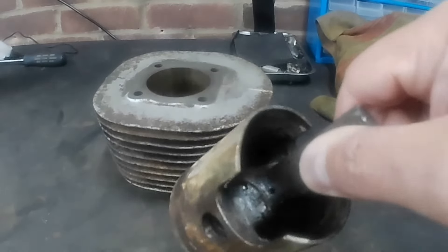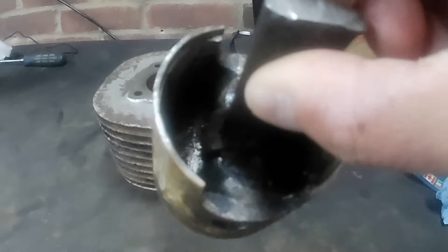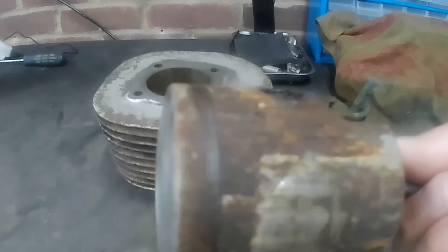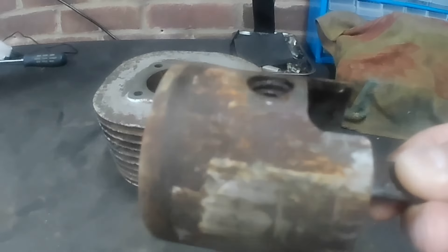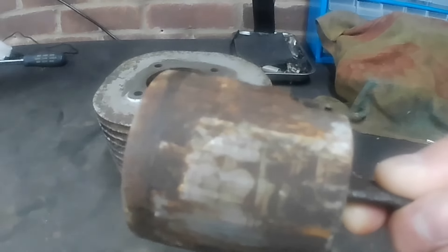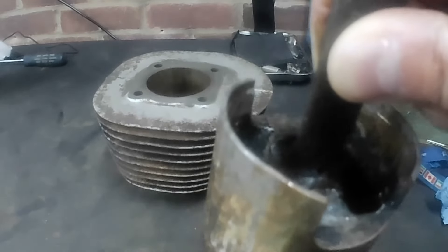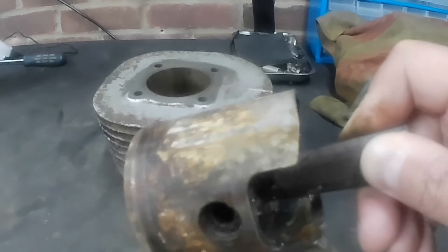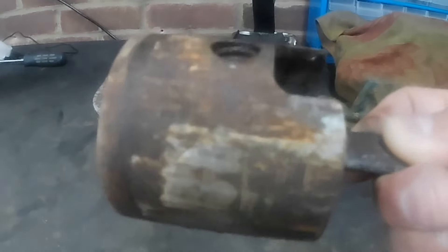I've had it in the press — you can see where I pressed against the gudgeon pin bosses, which are quite badly squashed. It wasn't as though we could have used this piston again anyway. It finally came free, absolute fractions of a millimeter at a time — moving a tiny bit one way, then back, repeated cycles in the press with force on it while heating up the barrel. Penetrating oil and repeated cycles eventually got it moving.